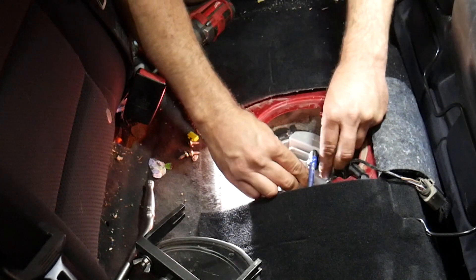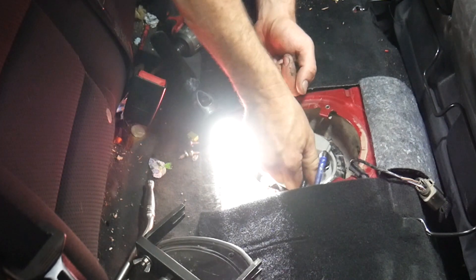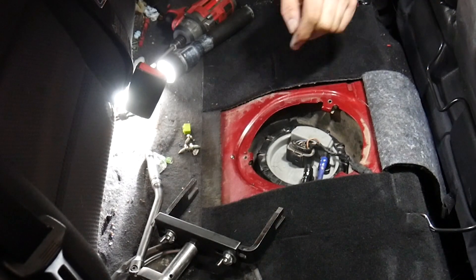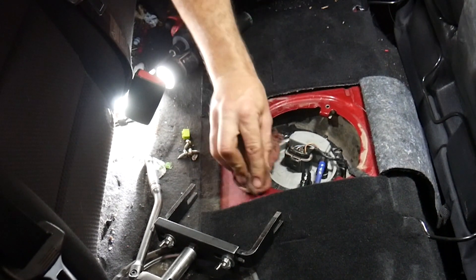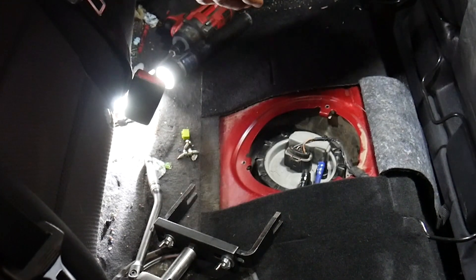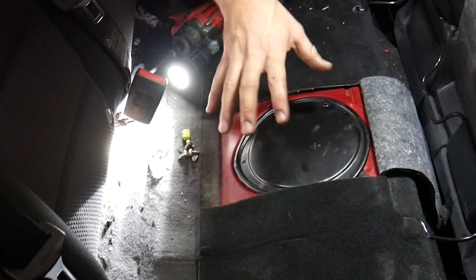This pump came with two little protective caps on the lines. Pop those off and the lines should clip right back on — make sure they are fully seated, give them a little tug, and plug the electrical connector back in. I was about to drop diesel fuel on the body here — luckily it did not make it to the carpet. Wipe that up before I put the cover back on so we don't have a smell. I'm going to rest the cover over this opening but I'm not going to screw it down yet because after I run it I want to verify that there are no leaks on top of this tank.